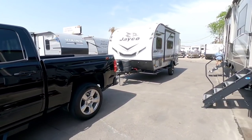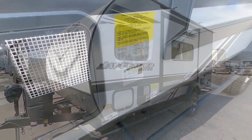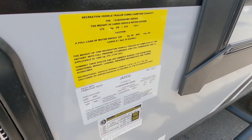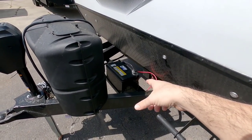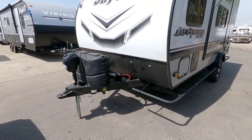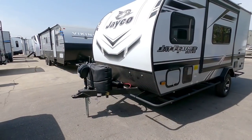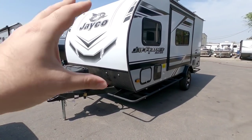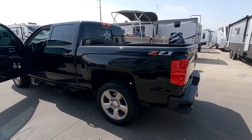The trailer we're using today is this brand new Jayfeather Micro — a really cool off-road inspired Jayco travel trailer. This trailer has a GVWR of 4,995 pounds, basically 5,000 pounds, and a cargo capacity of 835 pounds. But before you start loading anything in, you need to factor in the weight of the battery — which we added so we can use the trailer brakes — and the weight of two propane cans, roughly about 120 pounds of additional weight that will rest on the back of your truck. The first thing we need to do is take all of our measurements: measuring the trailer front and back in its level position, then the back and front of the truck in an unloaded position.